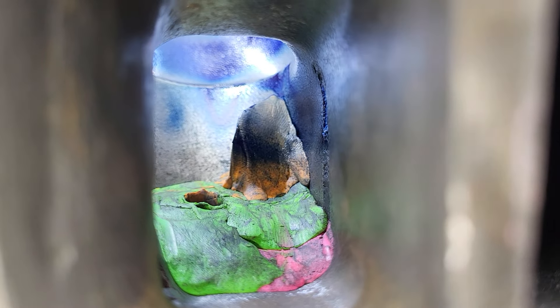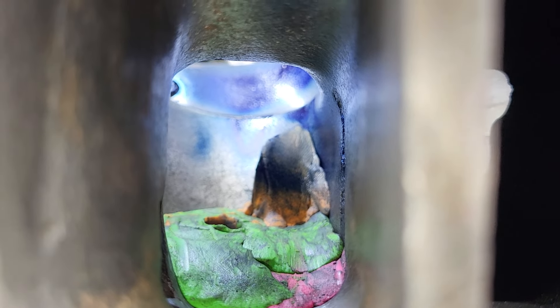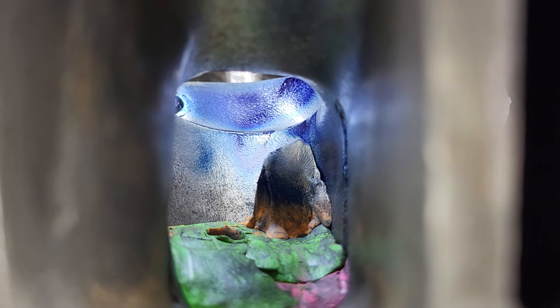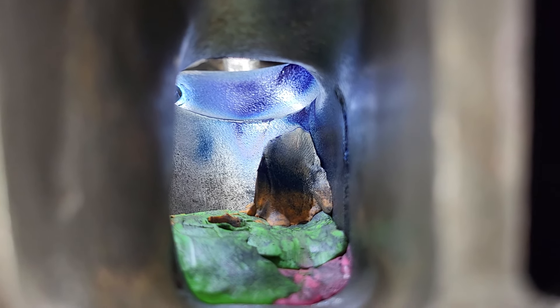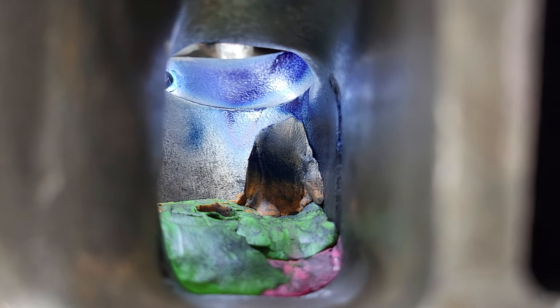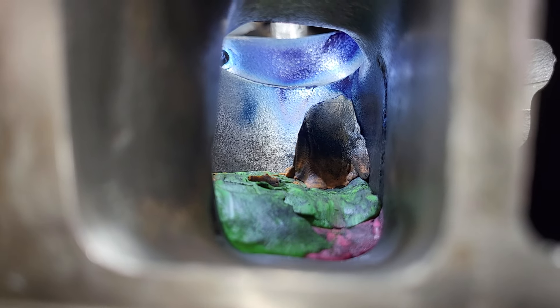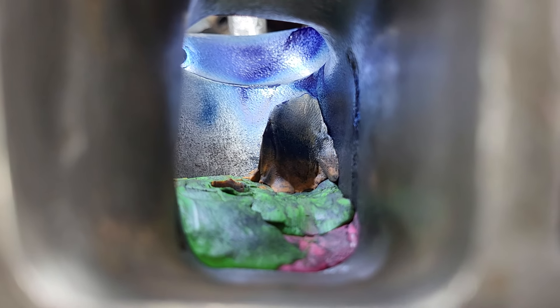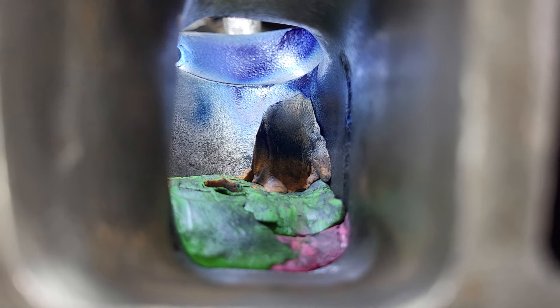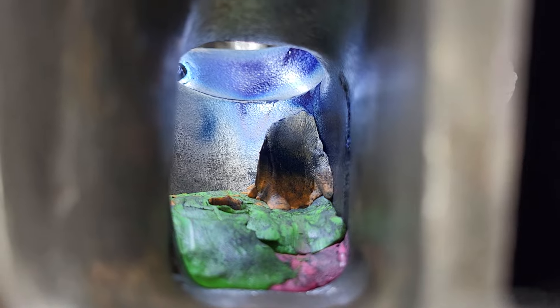This is kind of a mess, but we filled the bowl. Guys did the calculations of how much that was — we filled it. My guess was about 20 cc's, and I think I was pretty close. It's probably a 240 cc port though — I mean, it's huge. So if we take a look at our flow numbers for a 220 port, we're not bad, but we're not great either. We can see kind of what's going on with the fuel at this point.